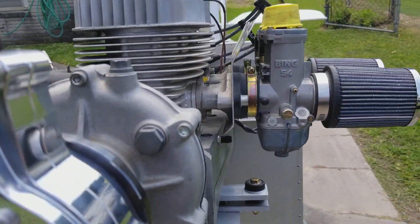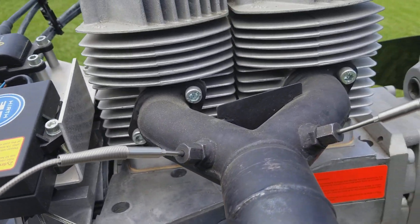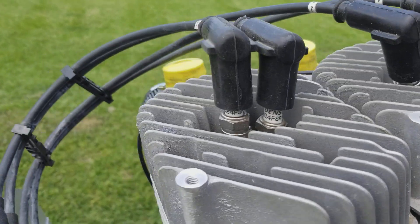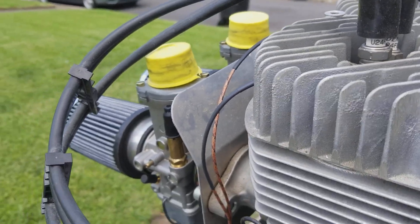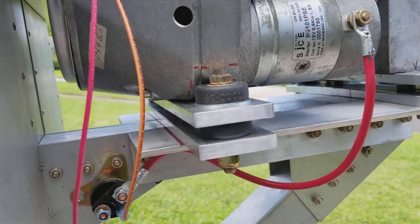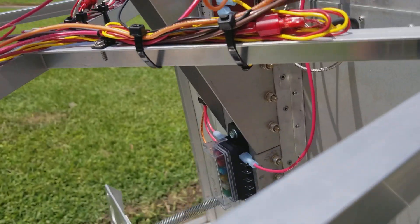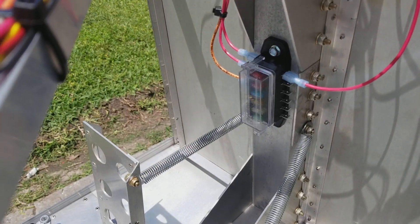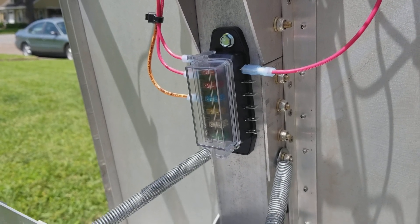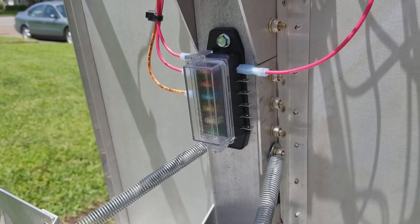Carburetors are on and tightened down. Exhaust temperature probes — EGTs — and also the CHT, which comes in on the other side. Got our solenoid down there with our battery and starter wired in, though no battery yet. Still debating on what type of battery and where it's going to be located. Need to get some scales so I can do a preliminary CG check. There's our fuse box — all 12-volt power supplies will come in on the right side and exit on the left.